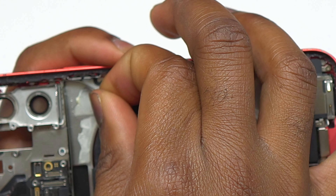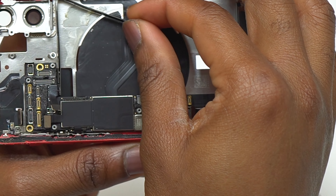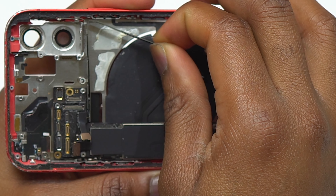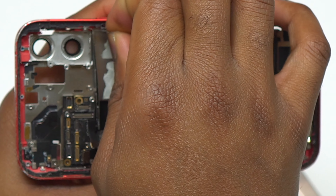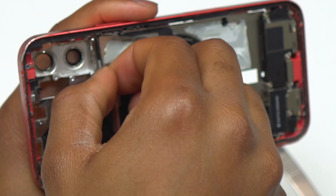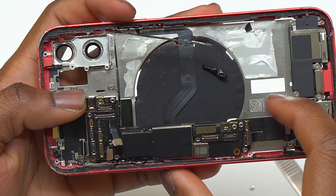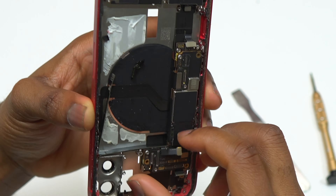To recap: remove all the screws near the camera module area, then remove all screws near the power buttons. After removing those screws on the flex cable, disconnect that flex cable from the 5G antenna attached to the right side of the device. After that, lift that portion of flex cable slightly — make sure it is moving freely; do not pull with any force, just pull slightly. Everything I'm about to do next should have been done before removing the component attached to the motherboard.